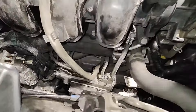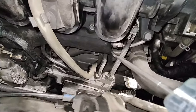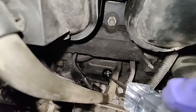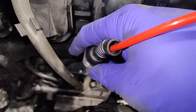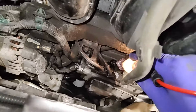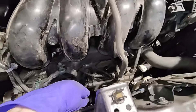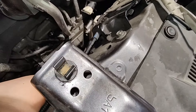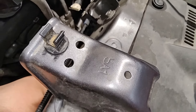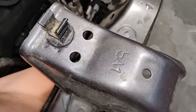Excuse the noise because everybody's working. Okay, just doing some quick simple checks. The starter is just down there - that's the battery positive power cable on the starter. Just want to make sure there's power getting to there, and I got a test light that lights up, so we're getting power there. Another thing is there's a connector for the starter solenoid, so I'm just gonna unplug it, get somebody to crank it and see if there's power getting to that one. Single pin connector on the starter.